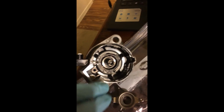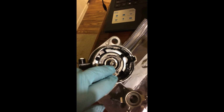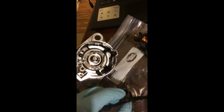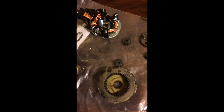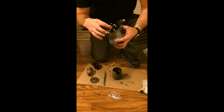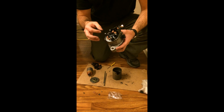And then the shaft for the final output, and you have three springs. You need to make sure they sit in their little holes. So we're going to snap this off and put the replacement on and then reassemble. We're going to be real careful when we push that back into place too. Let's press back in. The brushes are in their rearmost position. The springs are sort of staged up above. They're not in place yet.